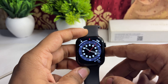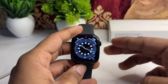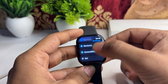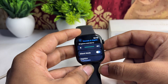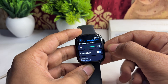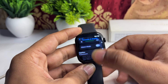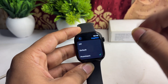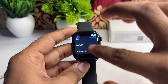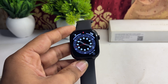The final step is to adjust sound and haptic settings. Go to Settings, then Sound and Haptics, and check that the volume is turned up and Silent Mode is turned off. Also adjust the haptic feedback settings to ensure you feel vibration when the alarm goes off — set this to Default or higher. These are the steps that can help you fix the alarm issue.